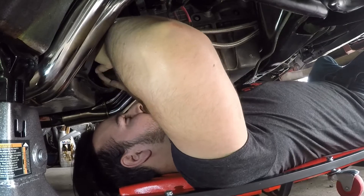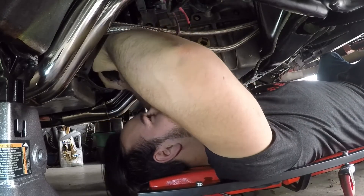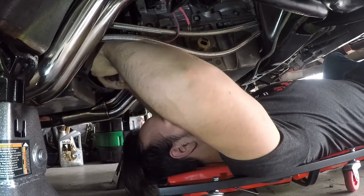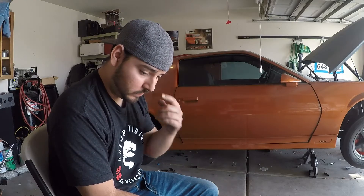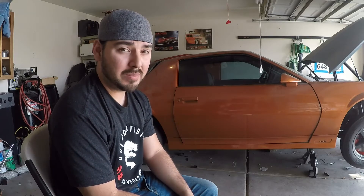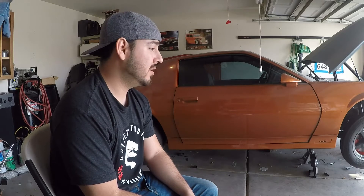I'm going to pull it out. Well, I couldn't get the torque converter to seat any more, so I'm thinking it's fully seated. Either way, if it is seated and it's not pumping, that means I have a bad oil pump on it. If it's not seated, I'm not going to get it on anymore — at least not without pulling the transmission and really putting some body weight on it. Pretty much means I'm pulling my transmission. I'm not excited about it.